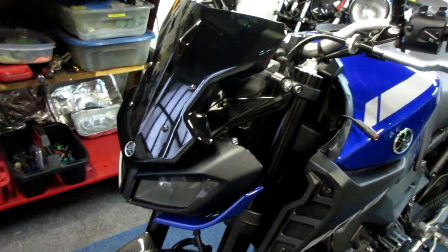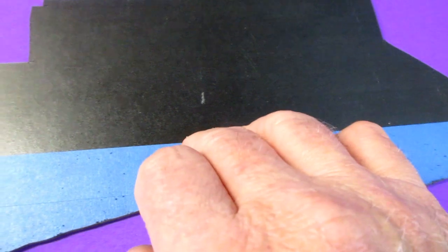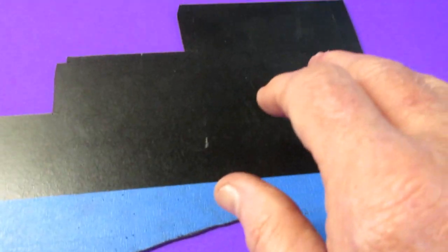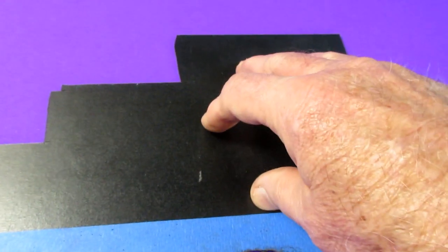Time to paint. Before I prep the part I want to share some basic 101 information about carbon fiber. This type of carbon fiber is typically used for an appearance part - this is not a structural part. Almost always it has a beautiful look, sparkles in the sun. This is unidirectional material - you can buy this off the internet, relatively expensive. Cutting it is really difficult without wearing a blade out. The thing is, almost always when you're dealing with anything carbon fiber that came from a mold, there's release agent on it, so I want to clean and sand that off.